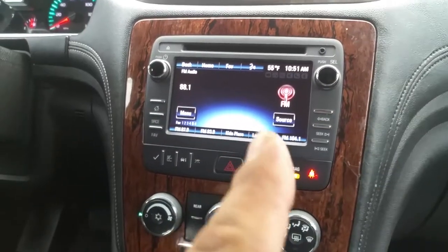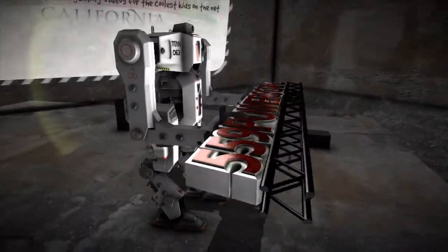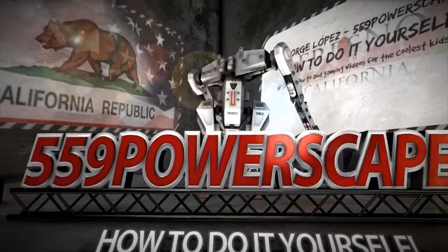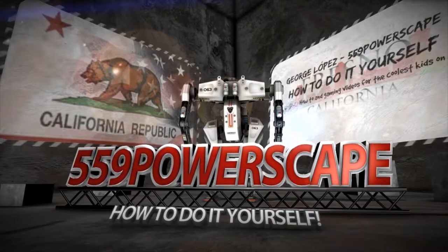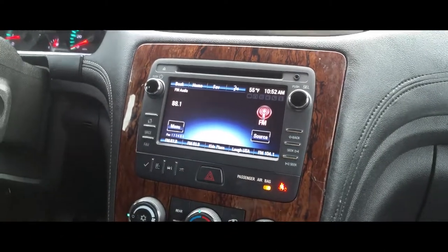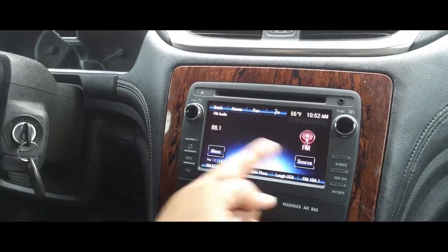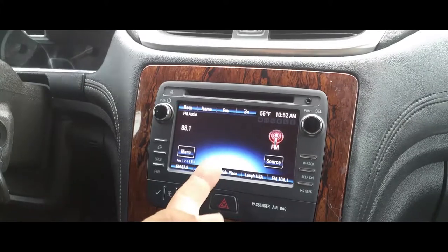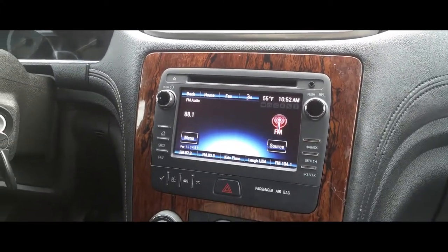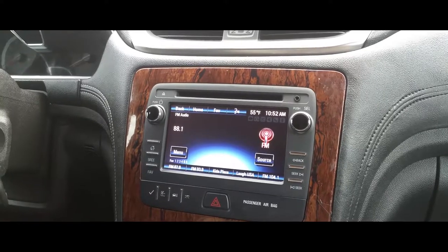Today I have a quick fix on how to unlock your head unit if you're replacing it or if you have a cracked one. I recently picked up this head unit from LKQ and as soon as I threw it on there it loaded up and then it said locked. I took it to a mechanic and he couldn't get it programmed. What I found out, thanks to mechanic Gus at Techniluve, is that you need to swap out the chips.